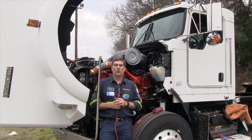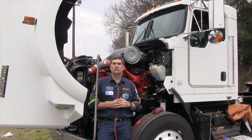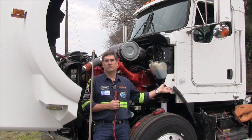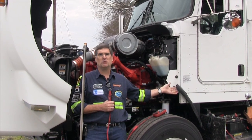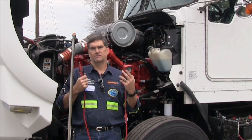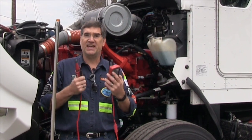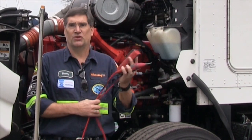I don't think any company that large will give a part number to a tool with a sharp point — they understand they don't want people in the field using those tools. That's all I've got. The Power Probe and Volt Pro do not have anywhere near the wattage dissipation to get a reasonable reading. On five ohms, they both showed normal voltage — but on five ohms, the Load Pro dropped almost three volts. That's the difference between being out there for 10 minutes versus 10 hours.